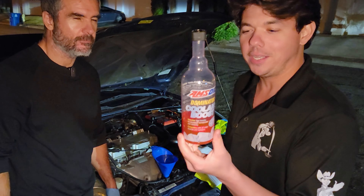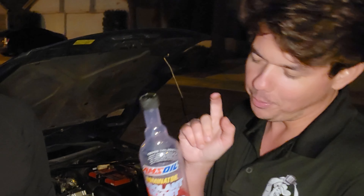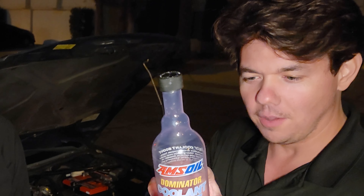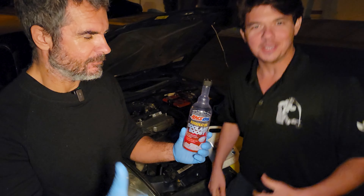It goes right into your coolant — as long as it goes into the radiator, you're good to go. Compatible with all other makes, models, coolants, and colors. You put two ounces for each quart of straight distilled water, and one ounce per quart of 50/50 mix. You can add more if you're running more distilled water for racing, but if you live somewhere extremely cold like Alaska running 60% concentrate, you don't need as much.